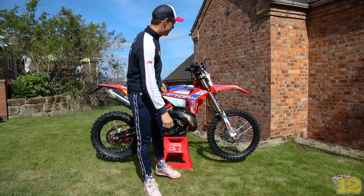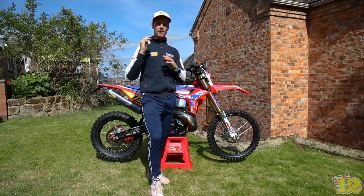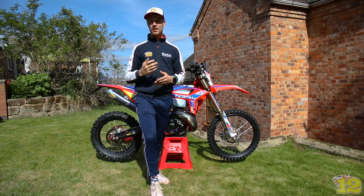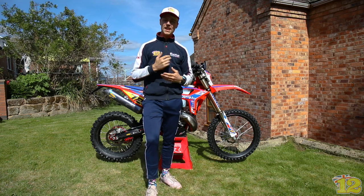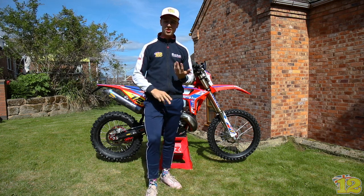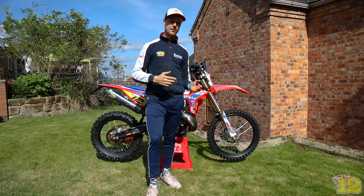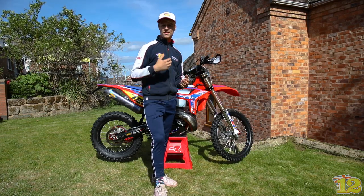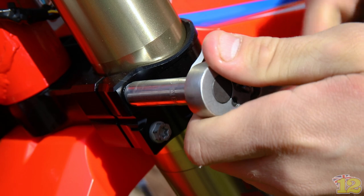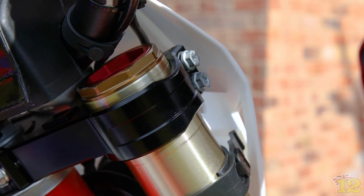Tip number three — we move to the front of the bike: fork height. This determines how balanced your bike feels, and it's all rider preference. Some riders like the front a bit higher, some lower, depending on how you like to ride. I like the bike to be really neutral front and rear because in enduro we race over sand, rocks, roots, mud, and dust, so we need the bike to work well in every condition. I use my fork right at the top of the top tube. But if I'm riding a sand track I'd push the forks all the way down flush with the top of the clamp, and if it's a dusty or slippery event I'd push the forks up a bit further to put more weight on the front wheel for grip.